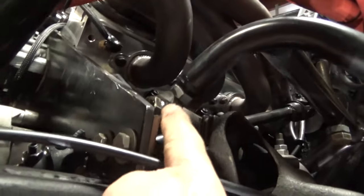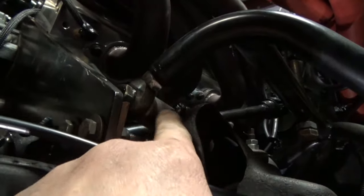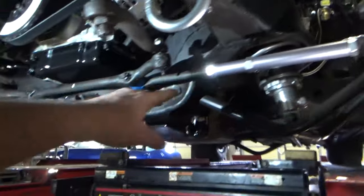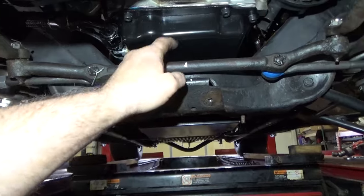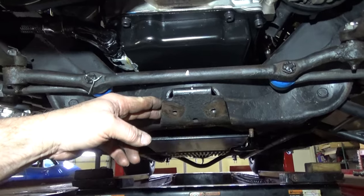I turn my turnbuckles on all four positions — both sides — to one turnout, and then I can make adjustments from there while keeping them even. I measured the tie rod ends were an inch off, and if you look at the center line of the car and where the rod end is, you can see it's about a half inch off. So we're going to square that up, set the front end up, and we're not going to care where the steering wheel is — we'll adjust that last.